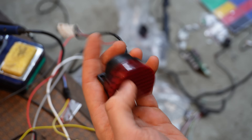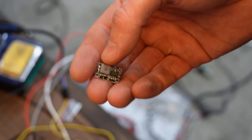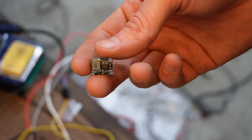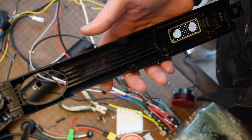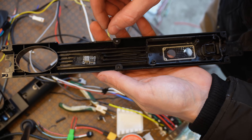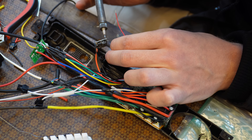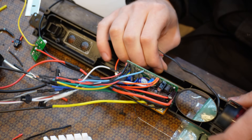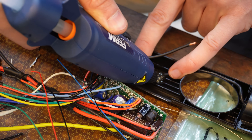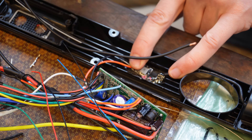Next up were the lights. Because these run off of 9 volts and not the 36 volts that the controller is actually supplying, I need to reduce that voltage. I decided to do that with a buck converter, which is this little module. I never worked with these things before, so definitely let me know in the comments if this is the best method out there. I'm placing this thing beneath the controller and soldering some wires to it - and if you see more wires than expected, that's because I also need to wire up the front light. After it was wired up, I used a very special high-end glue to hold all the wires in place, which is called hot glue, and I could finally start to seal up the new controller.